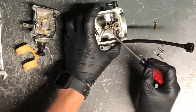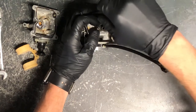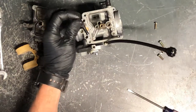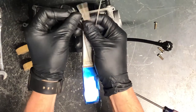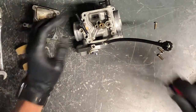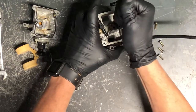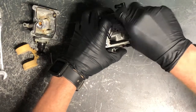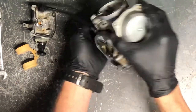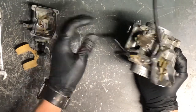You've got a secondary main jet here — a lot of carburetors just have a main jet and a pilot jet, but this one has a secondary main. Remove it the same way and make sure you can see and blow through it with compressed air. If you can't get compressed air through, that's where the jet cleaning tool is handy — find the right size and push it through to clean it out. The pilot jet is a small screw all the way down in this housing. Make sure your screwdriver is fully seated before turning — if it's not, you'll strip that brass pilot jet and won't be able to get it out.